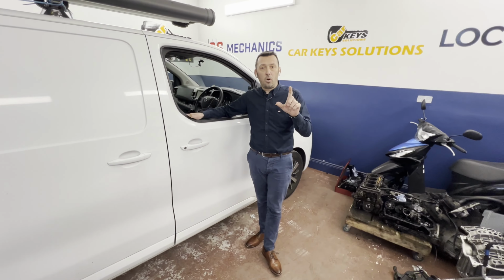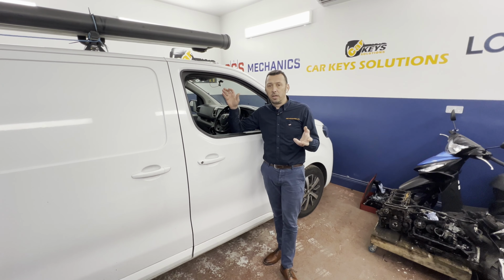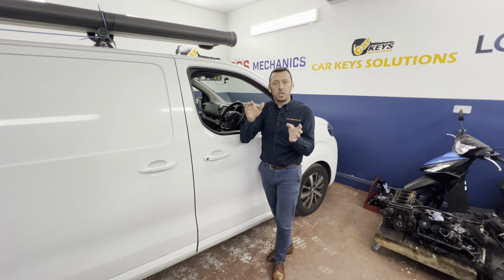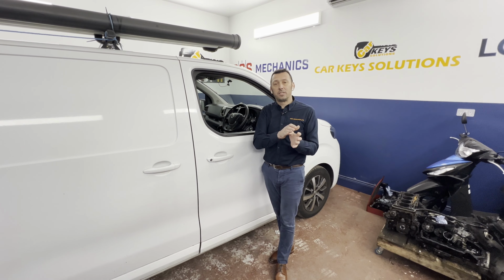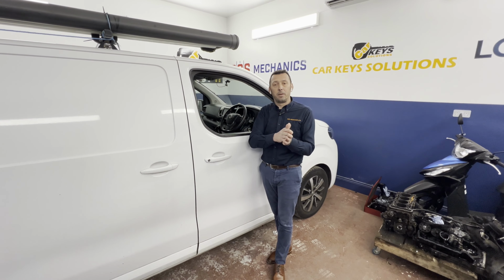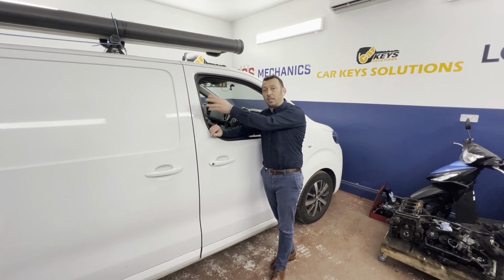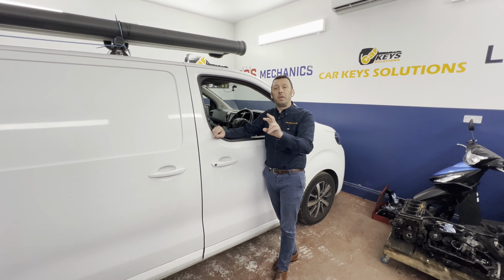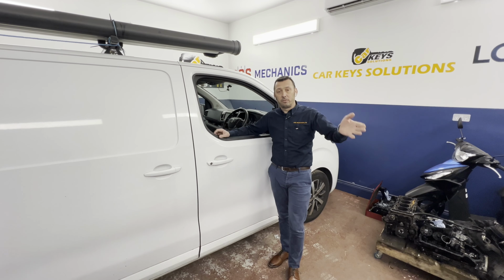First of all, you're going to hear a long beep for about 5 seconds or so, and afterwards you're going to hear a number of beeps. For each defective sensor, there's a number of beeps. So for number 1, which is the one on the far left, is 1 beep. For the one in the middle, 2 beeps. 3 beeps for the third one, and 4 beeps for the very right one.